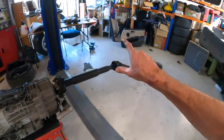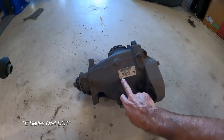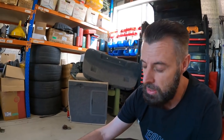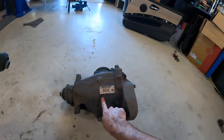You will also need the DCT diff. The E-Series N54s were supplied with a 2.56 diff ratio, which is quite different from the autos at 3.46 and the manuals at around 3.08. The reason you will need a DCT diff is that the car monitors wheel speed and diff ratios, and if the wheel speed isn't matching what it should be doing at, say, 4,000 RPM in fourth gear, it will throw an error code.